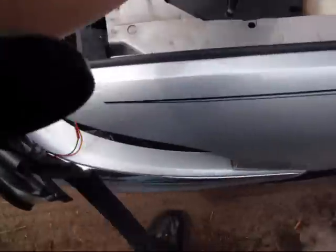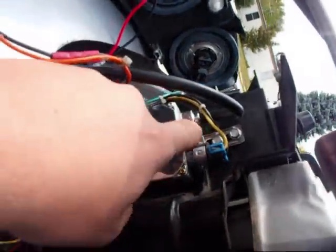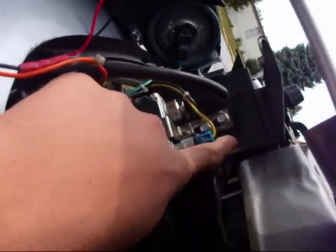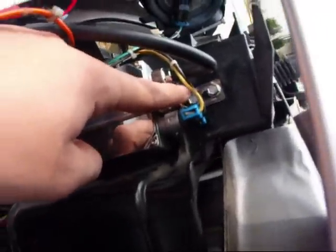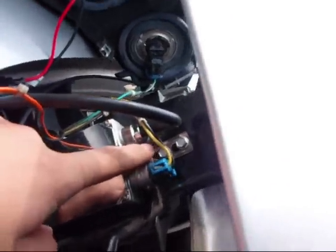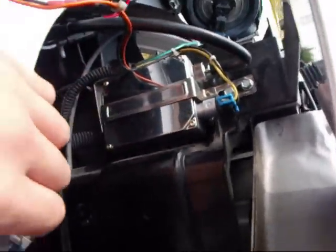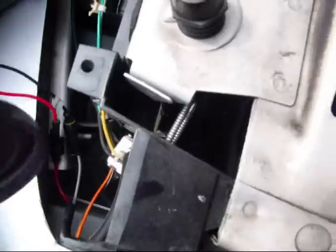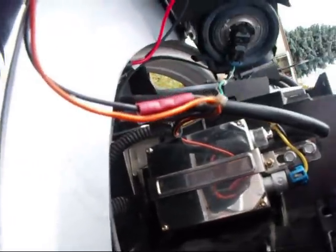How the HIDs are installed: it comes with a ballast, like a fluorescent light — that's that thing right there — and it also came with a bracket to mount it. For this piece of metal right here, I just used two self-tapping, self-drilling sheet metal screws, about two inches long. I drilled them through that thick piece of metal and they come out on that side. They're out of the way and not going to hurt anything.